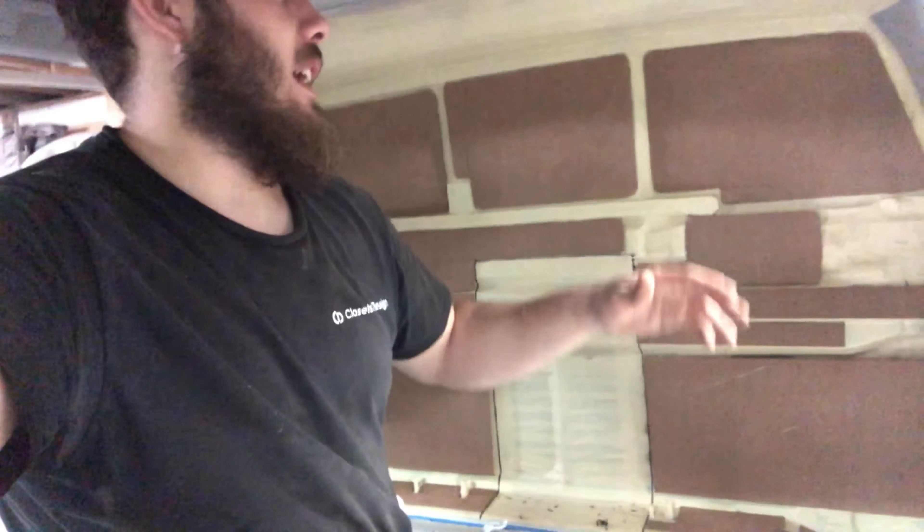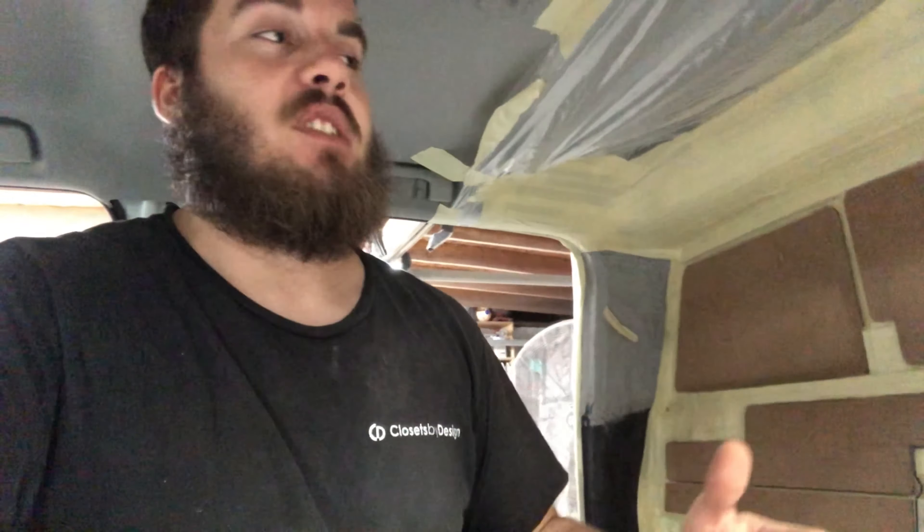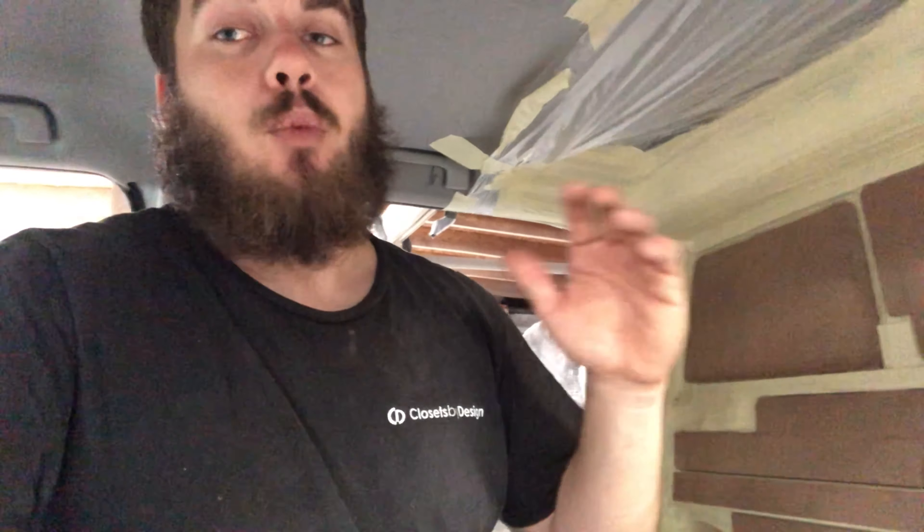All the prep work is done. I got the pillars sanded using a DA sander with 30-grit and really put some heavy grooves into it. I also went through with an eighth-inch drill bit and drilled a lot of holes — basically Swiss-cheesed it. You want the glass to go into the hole and loop down so it actually holds on to the panel itself. I've seen it — and even made the mistake myself — where fiberglass seems to stick after sanding, but a lot of times it doesn't want to bond to this plastic. Lightly sanding is not going to work. You have to really heavily sand and grind it, and I'd even recommend putting in the holes so the fiberglass has something solid to bond to and droops into the panel.